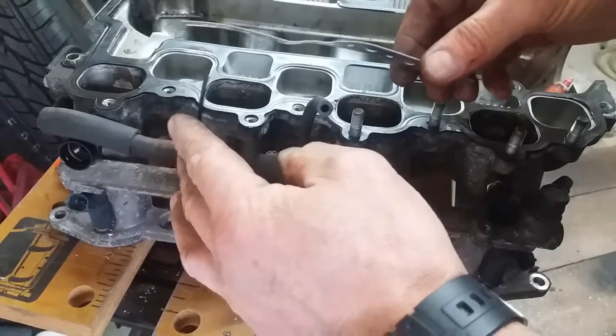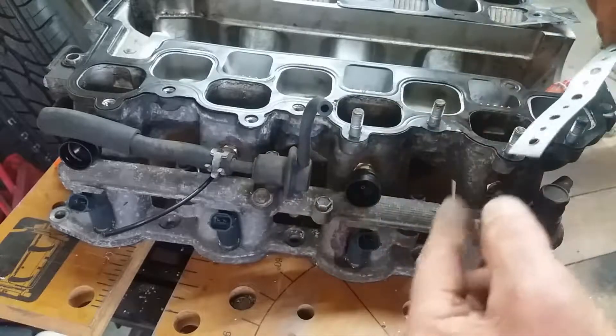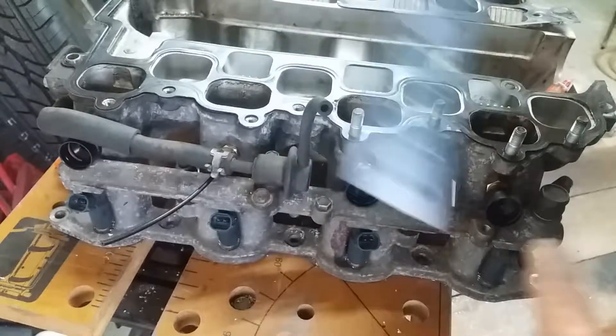This is not what's going to be used, just as an example. We'll mount it onto a mounting bolt for the plenum, and then by setting the injector vertically through a 10mm hole, you can cut the pipe to an appropriate length. The plenum chamber is massively high and then the engine cover on top of that, so we've got lots of scope to do that. Fuel will come in at one end, daisy chain around, and we'll get the return back out from the other.